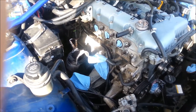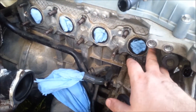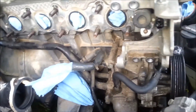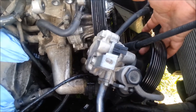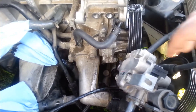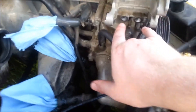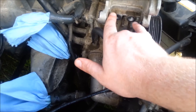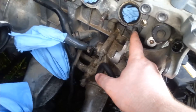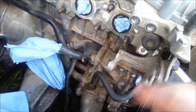That's kind of a tricky thing to do — these bolts here can't be reached with the power steering pump in place. To remove the power steering pump, there are actually two bolts that you look through these little eyelets, take those two bolts out, and then you just give it a tilt and a tug and it pops out. It's only retained right here.